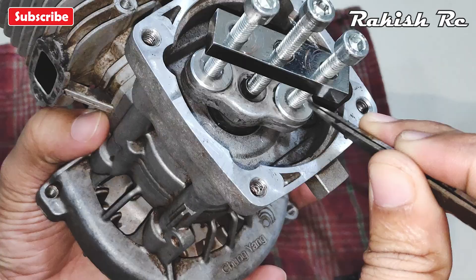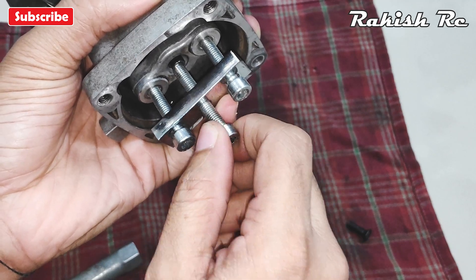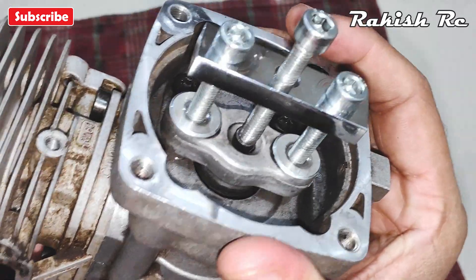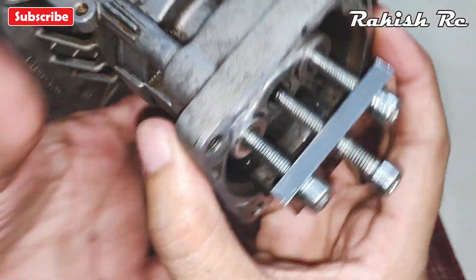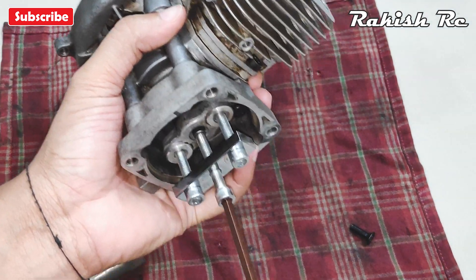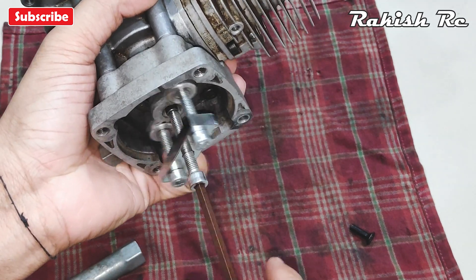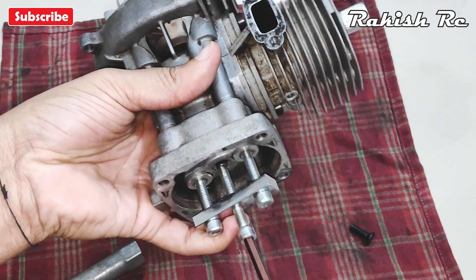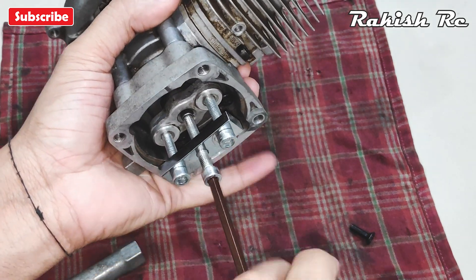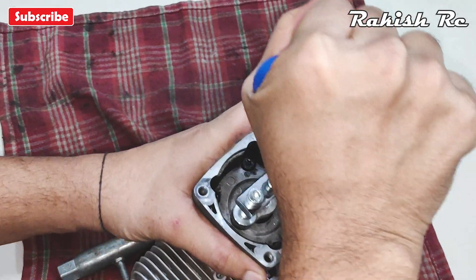The proper way of using the flywheel puller is to have the metal bar seated just below the cap of the screws — otherwise you won't get the leverage needed to generate the pull to extract the clutch carrier. Make sure the screw cap is resting on the metal bar of the flywheel puller, otherwise you will just keep rotating the center screw and won't be able to remove the clutch plate. With the M6 hex tool I'll remove the clutch mount.